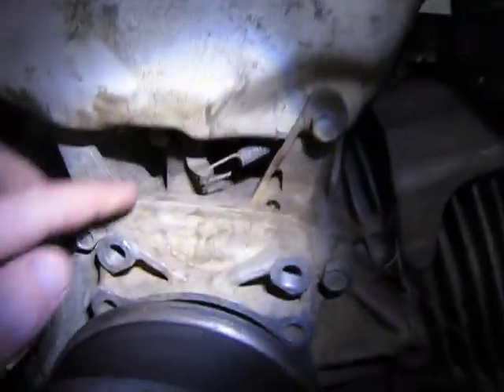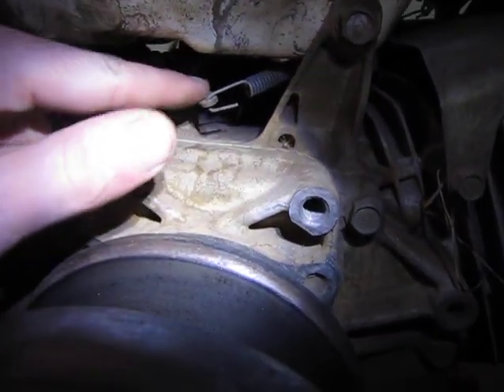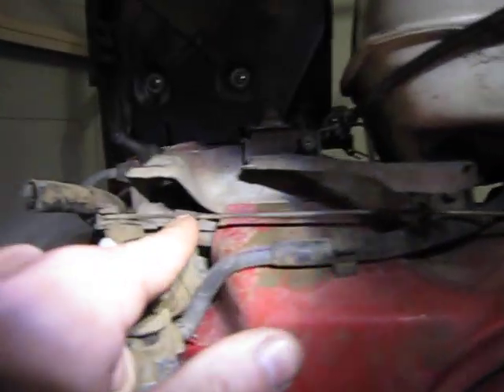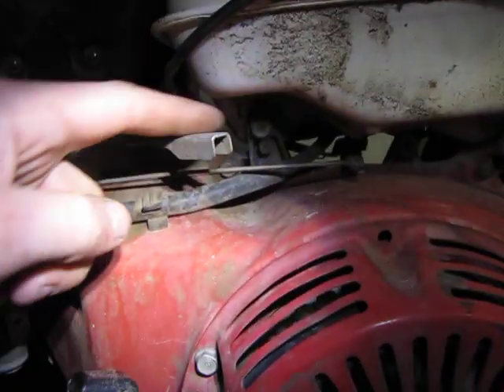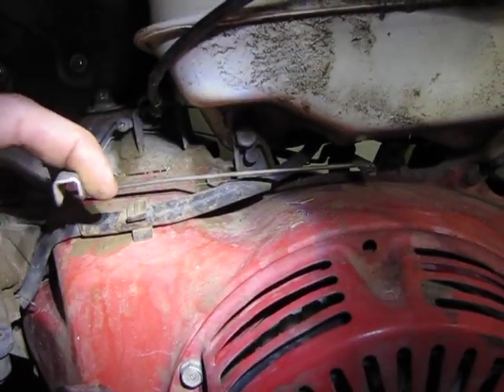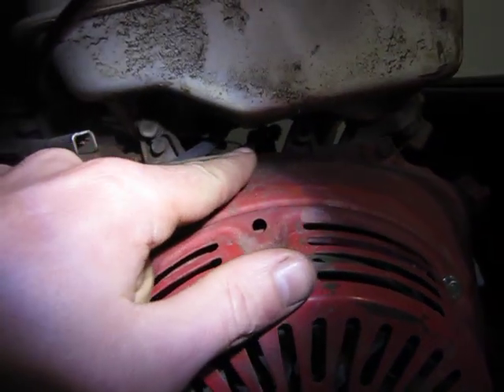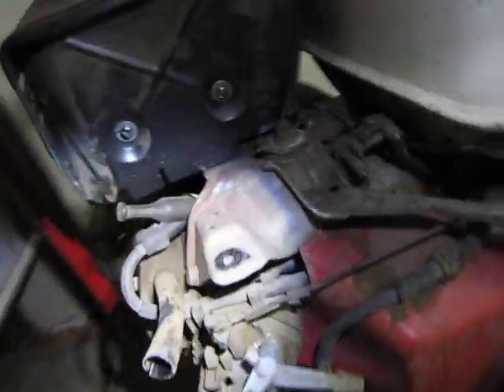This little spring is right here. So when you step on the gas, it moves this spring which is connected to this arm. That arm, if you look back on the other side, it's connected to a little rod and a little spring that goes around the rod. So when you're idling it should look like this, and then when you give it some gas, it pulls that arm through that spring that's on the other side, connected to this arm, which is connected to this rod.